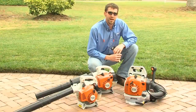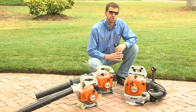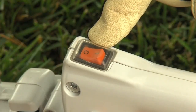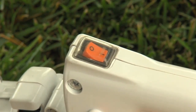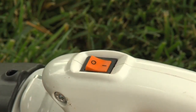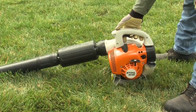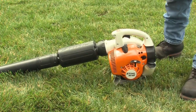It's very important to identify what types of controls you have on your blower before going any further — there are several versions or combinations of controls depending on which blower you have. This is a manual on-off switch; before you start your blower, you always need to make sure you place this in the on position. If you fail to do this, you will most likely flood the engine. This is a stop switch that automatically returns to the start position, a style used on many of the newer STIHL models. Once you turn the engine off and release the switch, it automatically reverts back to the run position, so you don't need to worry about this step the next time you start your blower.